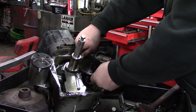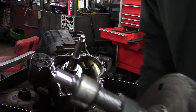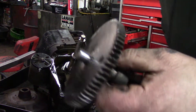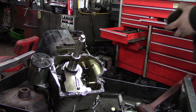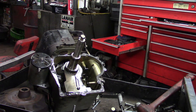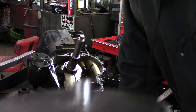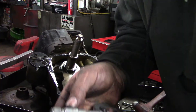Put the cam out — I'll show you some things there. Looks really nice. Let's look on the end there — that one looks really nice, there's no wear on that. I'll show you a cam that is worn. You can see that right there — see that groove on it? That's right where the oil slinger goes. That's no good. The spec on these cams, the reject size is 0.498 from Briggs and Stratton. This camshaft is bad.